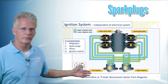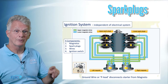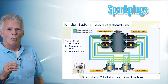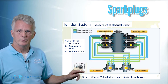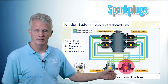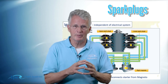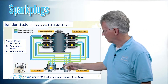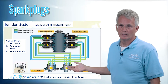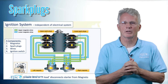Now the third part of this ignition system are these wires. Notice in our diagram these wires are color-coded blue and green. When you trace these wires you see two green ones and two blue ones from each magneto. The green wires run to the spark plug in the top of the cylinder. The blue wires run to the spark plug in the bottom, or the lower side, of the cylinder.